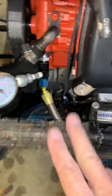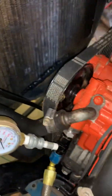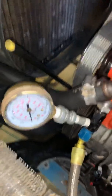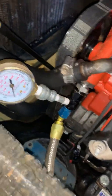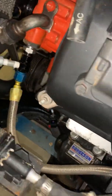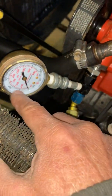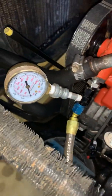This is a factory cooler off a junkyard car with the reservoir. I hooked up a pressure sensor so this pressure gauge tells me how much pressure is going through the power steering pump. I play with the springs in there and realized when you're not turning the wheel there's no pressure — it only builds up when you hit the stop or as you're steering, and that's when you'll see the needle going up and down.